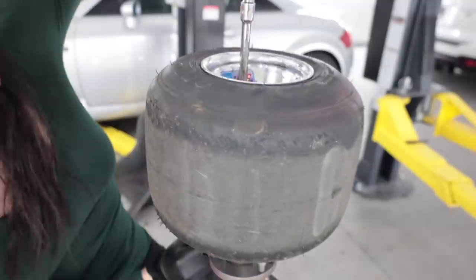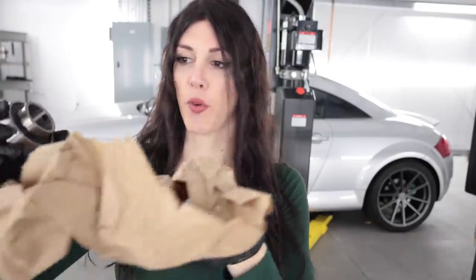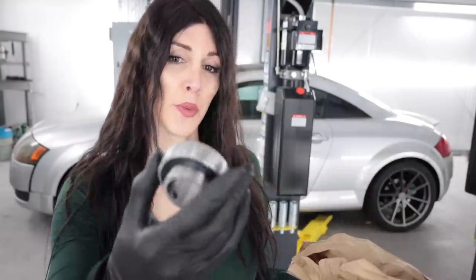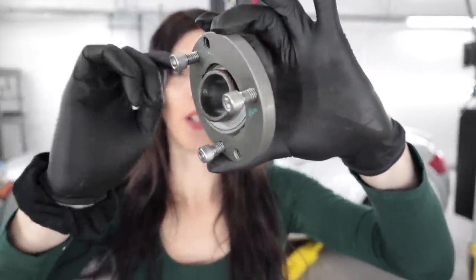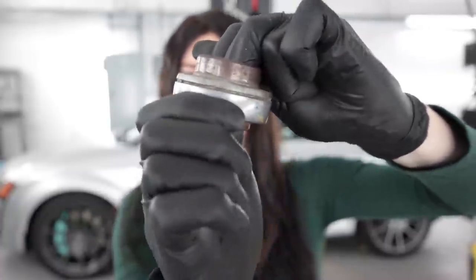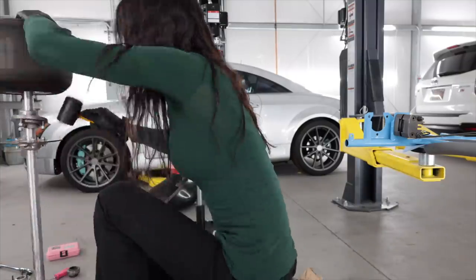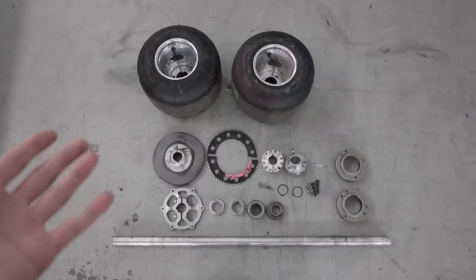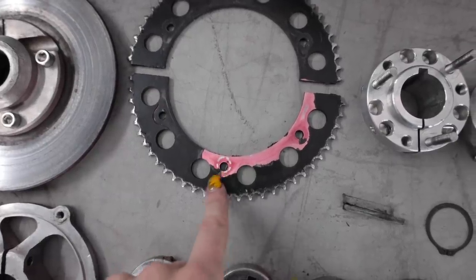Another day and another package — got some more parts for the go-kart, this time for the rear axle. So these are the axle bearings, which are shot. But inside this is not some fudge or a sandwich from a deli, but some axle bearings. I wish this was a sandwich from a deli because I'm hungry. Let's try not to get this in the eye. I need this thing out of its carrier, and it comes out because magic — you just turn it sideways. Tada! I can't even turn it — that's how seized this bearing was. In comparison, the new one is nice. Tada! Freshly disassembled rear axle. And I also discovered the rear sprocket looks like it used to be anodized red and someone painted or plastic dipped over it. So I'm gonna peel all that off and clean it up.